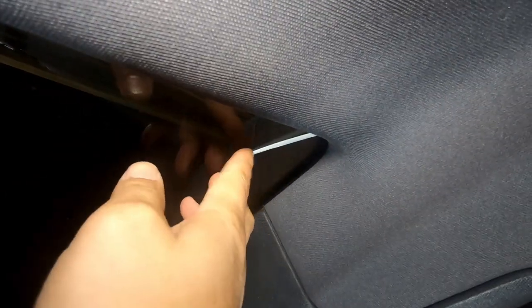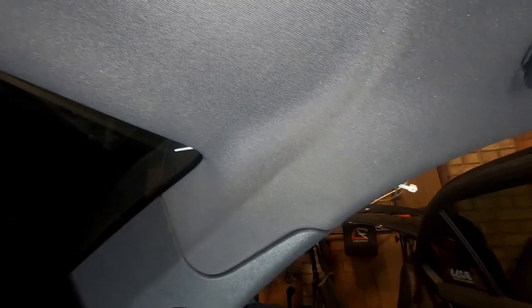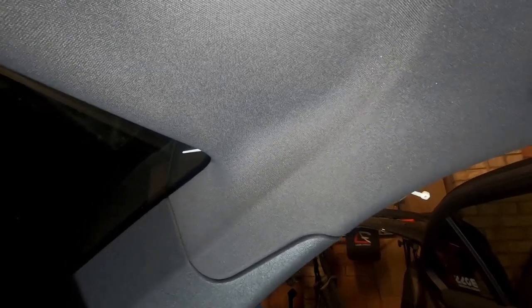It's just tucked in the roof lining. In order to get past this part here without having to remove all this — because it's a pain to get back in place — just use an extra long hose tie, maybe tie two together. Notice how that hose tie is there — if you duct tape your cable to it and then push your hose tie through, notice how it comes out the other side. This would be the easiest way for you to get the camera cable through the roof lining without having to remove any of this stuff.